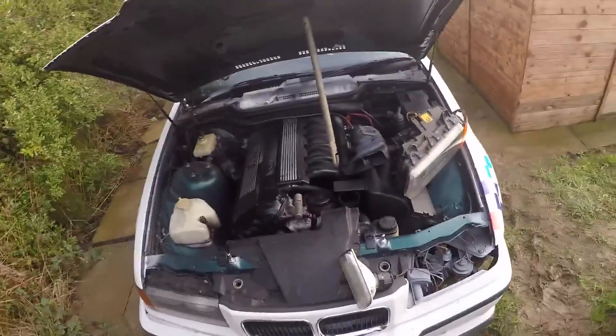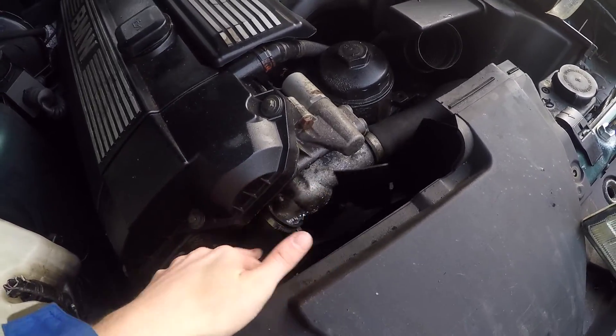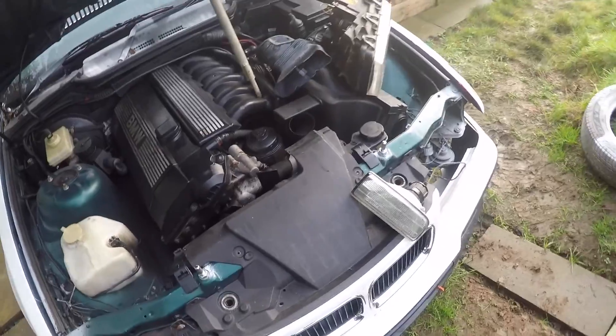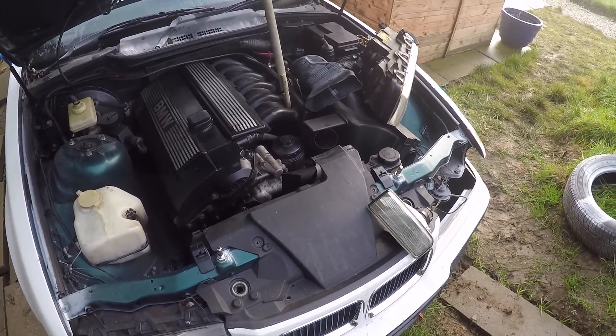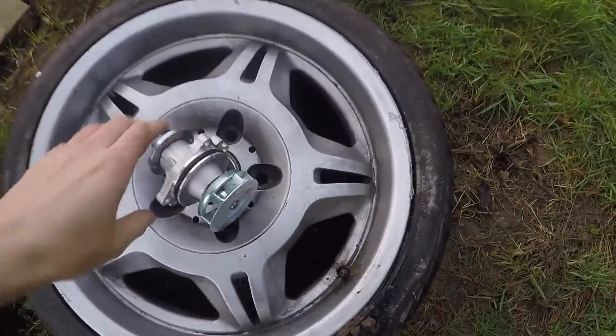So the next part of the build is having a look at the cooling system. People say they're weak on E36s — there's some truth in that if you're buying the car as a road car and never do any maintenance, but for a track car because you normally address it, I don't think they're that bad. Key things are, on the six cylinders, you get a clutch fan. I'm skeptical about mine — I think mine's had it, because it did overheat a bit sometimes when it was at standstill. The part to look at is the water pump — it's well known that the original BMW ones had plastic impellers, and all the good replacement ones have metal impellers like this.